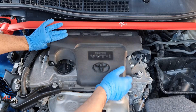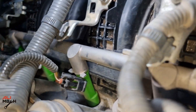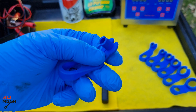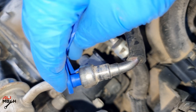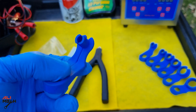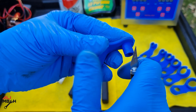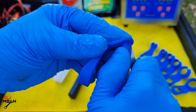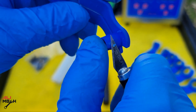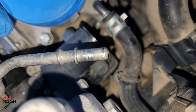Let's remove the engine cover. The fuel injectors on the 2017 Toyota Camry are located at the back of the engine. First we need to undo these three 10-millimeter bolts for the clamps and then disconnect the fuel line. Let's remove the protection cover and use the 8-millimeter fuel line disconnecting tool. The lips were too thick to push the lock mechanism open, so I shaved some material with a razor blade to make it thinner — I'll put links to better brands in the description below. Now it works much better.